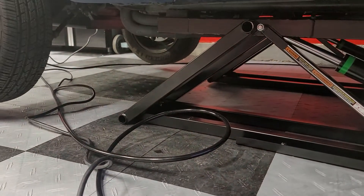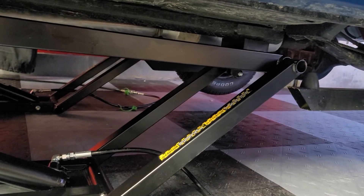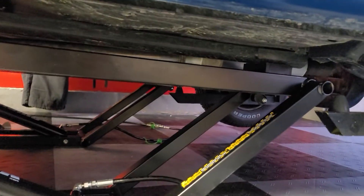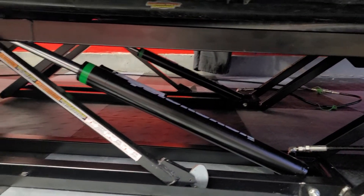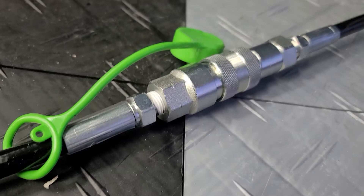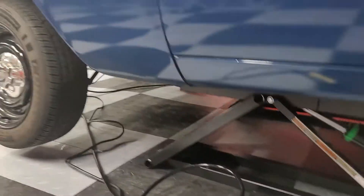Here's the quick jacks on this car. With the traction bars at the back, the only way I can fit the lift is from the subframe connectors, which I've never done before. But the car is perfectly strong — it's braced all over underneath — and it lifts perfectly well. I didn't see any flex, so I think it's a good spot. The bleeding is pretty easy and it's easy to set up. They give you thread sealant compound, but that didn't work at all — I had to seal most of the thread fittings with PTFE tape to get rid of some pretty big leaks. After that it works great.